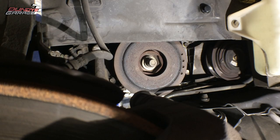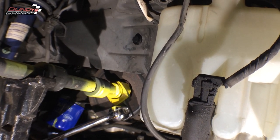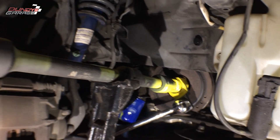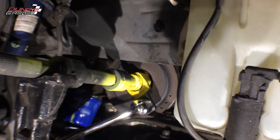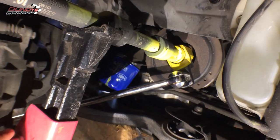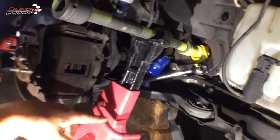Looks like it's gonna be one of those stubborn ones. Next thing I'll do — I'll put some penetrating oil back behind the washer. Don't touch that, it's super hot right now. Then I'll get out my three-quarter-inch breaker bar with extensions and a three-quarter-inch 19 millimeter socket. I have the crankshaft pulley tool in place — I'll put a link in the description below, you can buy it on Amazon. I have about eight to ten inches of three-eighths breaker bar going right through the center of the crankshaft pulley tool, and I have a half-inch breaker bar down against the floor resting on a three-ton floor jack.